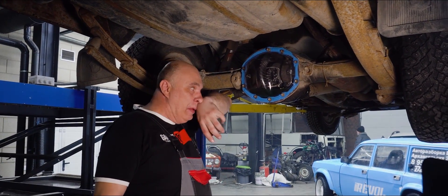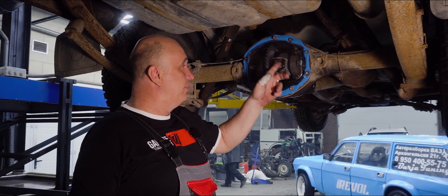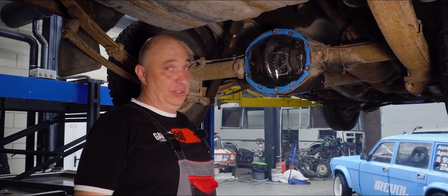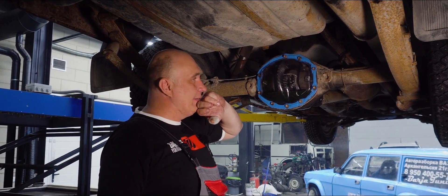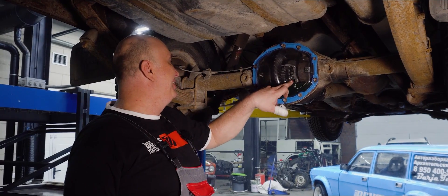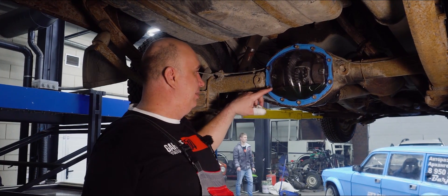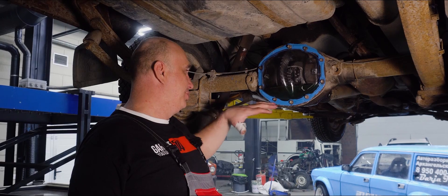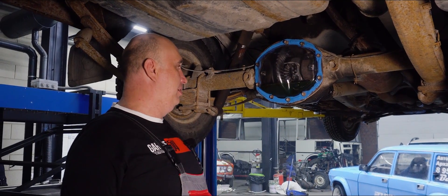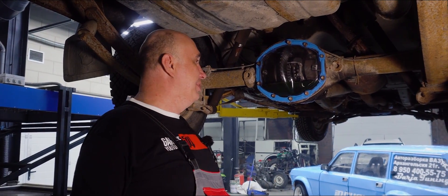After pouring in a liter, it doesn't look like much. The gear is touching the oil and so it is going to splash it around — every component should get lubrication to some capacity, but we are meant to put in some more. If we go all the way up to the recommended level, that's actually in excess of two liters. The repair book says 1.65 liters. We've brought it to a level where the planetary gear is lubricated quite sufficiently — it's dipped in there pretty deep. So we won't put any more in, we'll cover the filler hole, and it's time to start the car and see what's up.